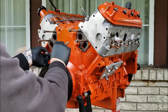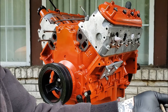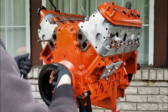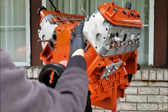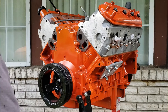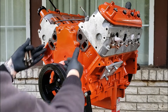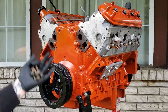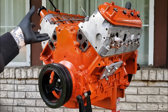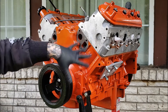When installing your water pump, you need to remove your old one. The old one is held on with six bolts, and it pulls straight off. But before you get that off, you need to remove your belt, and sometimes you might need to move your alternator bracket, just depending if you've got room to work or not. You won't have a front fan and you shouldn't need to remove your radiator. The truck water pump does have a fan on it and you need to remove that fan — it's a little more difficult, but pretty much the same setup, six bolts.